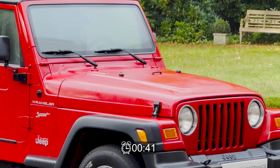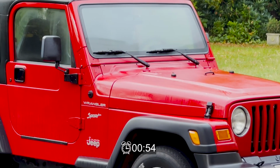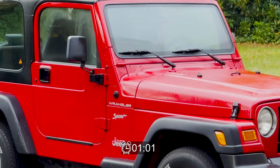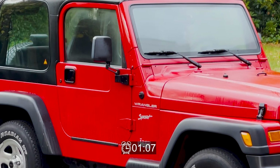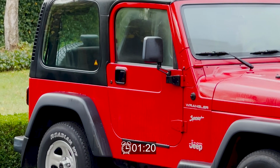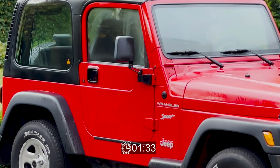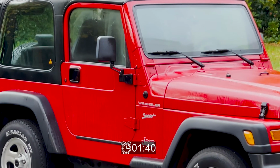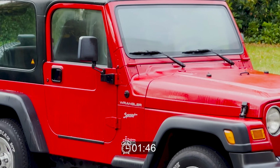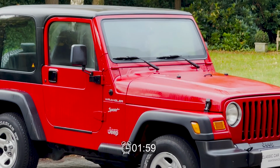The process is very straightforward, really. You want to spray the product on your car paint and wait until it turns purple where it reacts with iron particles. Don't forget to wear eye and hand protection while spraying because iron removal spray contains muriatic acid. No big deal, but that's not the stuff you want to get on your skin or in your eyes. You don't want to inhale it either. Just spray downwind to avoid getting the spray mist all over you, and use common sense.